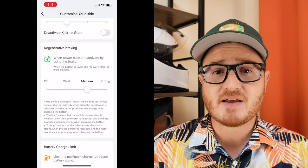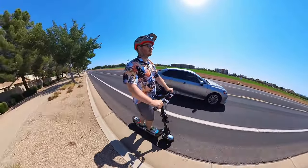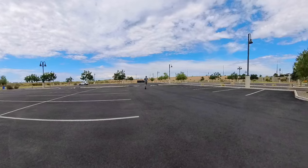If you're riding on flat ground and you're not too concerned about range or battery capacity, go into the settings in the app and just disable regenerative braking. That way, when you release the throttle, you just coast. Keep in mind that even though you have regenerative braking off, when you hit the brake levers you'll still have electronic braking in addition to those disc brakes activating — so you're not losing any kind of electronic braking power. Overall, acceleration is very strong on this scooter. If you live in a busy city and need to get up to speed quickly or need extra power for hairy situations, the KQI 300X has plenty of acceleration to do just that.